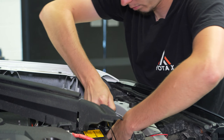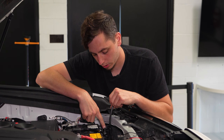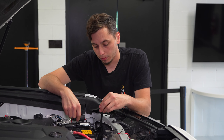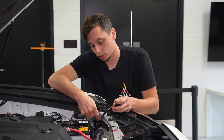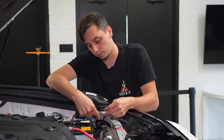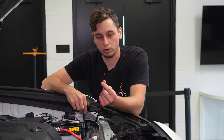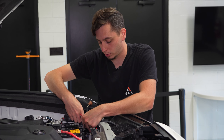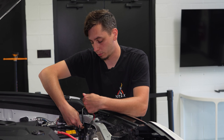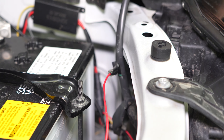We've got that plug out — you can see we actually have a wire tap in here from a previous install, so we're going to use that same wire tap. You can use the wire tap where the wire is exposed near the plug, or you can cut the wire protector off a bit further down and tap the wire there. We'll take the red wire from the raptor light harness, stick it into the wire tap, and use a small pair of pliers to clip it into place. Then plug the headlight plug back in.